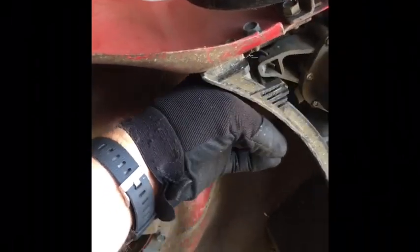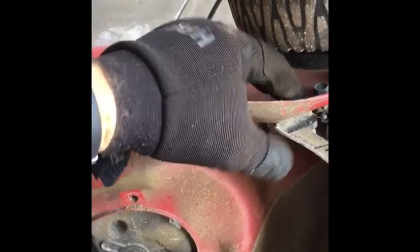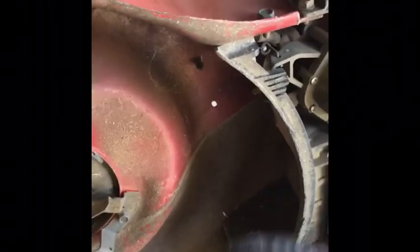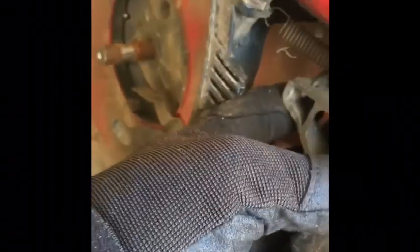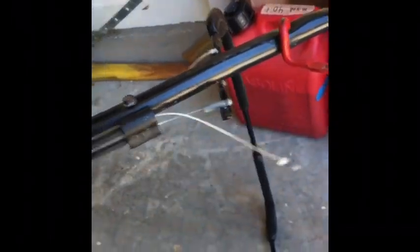I've already taken off the pulley stuff here. In order to get access to put the belt on, I have to take the belt guides off, and to do that I have to remove this baffle, and to do that I've got to take the wheels off in the back so I can get access to that bolt in there and pull this out. There are some bolts in the back too. An important step when you get the baffle out — because it's all connected — the cable is connected and you need extra slack. Go up here and disconnect it from the handlebars. That gives you more slack so you can move around and not have to deal with it later, but remember to put it back.